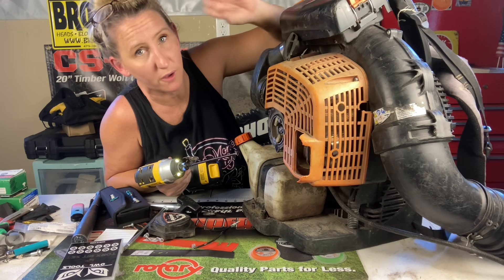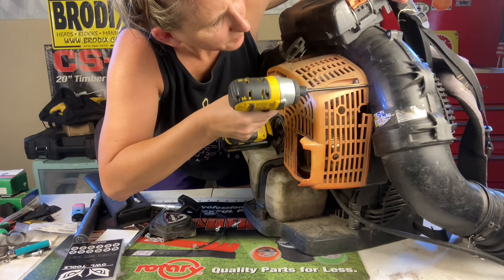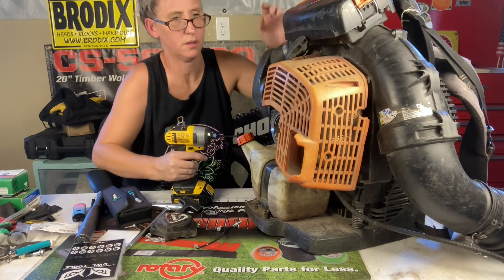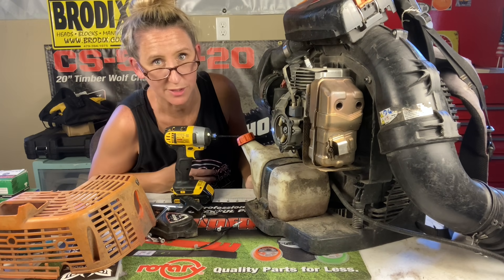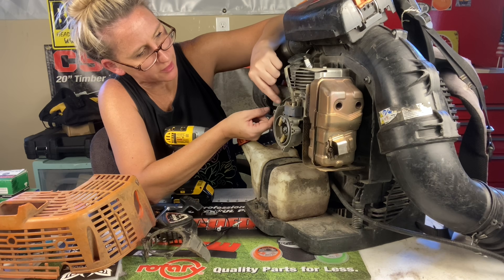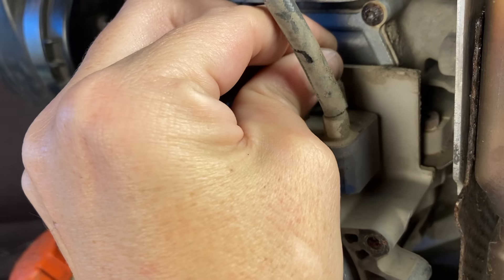Next we've got one screw right here — now these might be a little tough in the beginning because they all have Loctite on them. You've got one, two, three screws to remove this entire outside cover. We do want to take the plug boot off — twist because you do not want to pull the plug boot off the coil wire, so make sure to twist it before you pull up on it. And this whole thing comes off really simple, which is awesome because even though the PB770 is one of my favorite blowers, it's like 18 screws to get the cover off, which is sort of ridiculous. So we're going to take this piece off right here and you can see the wire — oh and there's a big pinch part right there too. Wire goes to our coil. Now that's pretty much all we have to take apart — we're going to disconnect it from our two ends here and unscrew this one right here. That's all it is.